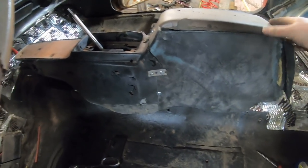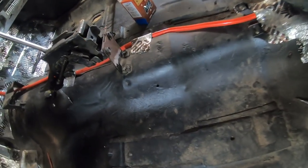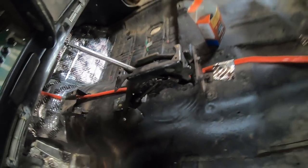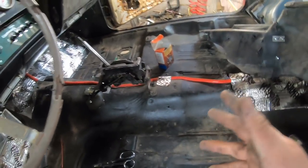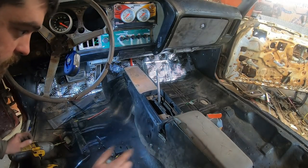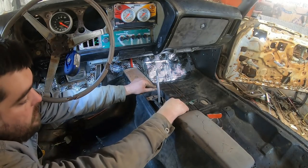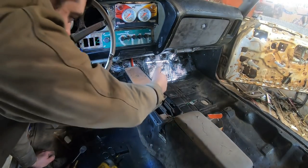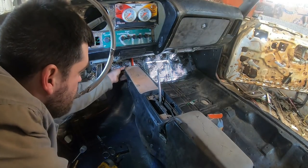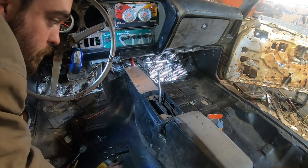I got the console in, but it's sitting high on that shifter. If you look at the back side of these things, those holes are slotted, so we can move the shifter down about an inch and that'll probably give us what we need. That's a fair bit better — still high though. Couldn't have anything to do with how I constructed this console. I refuse to even acknowledge that that is a possibility. At least it is in the vehicle. We'll screw it down where the original 8-track player goes here — that'll hold the front of that shifter down too. Two birds, one stone.